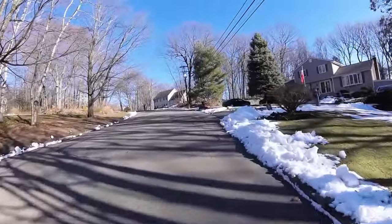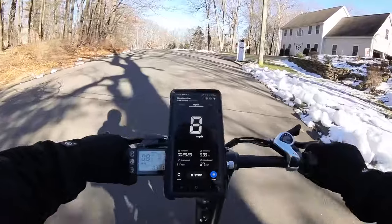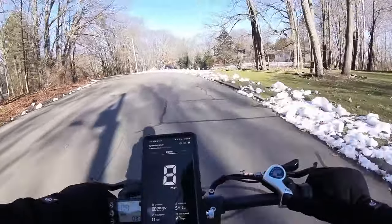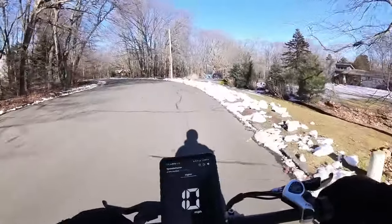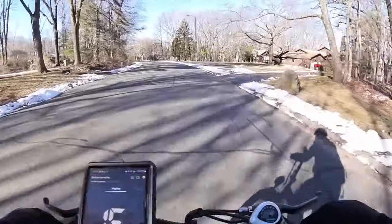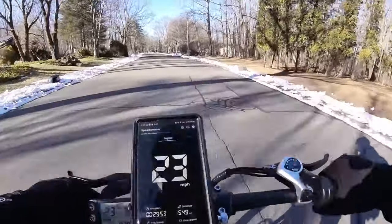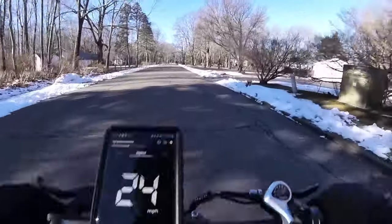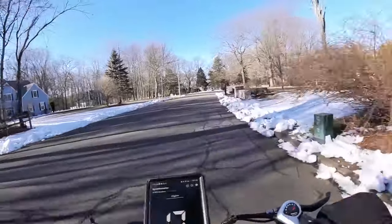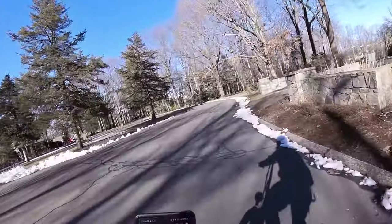With the seat higher, it's not bad — you get more leg extension. Under full load the voltage reads about 37 volts. I did fully freshly charge it to make sure it had maximum charge. Let's throttle and pedal as hard as possible to find where ghost pedaling is. I can't really experience ghost pedaling with this bike unless you're going down an insanely steep hill getting most of your power from gravity.